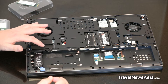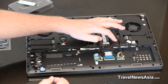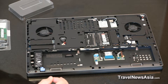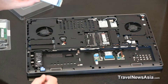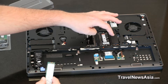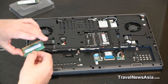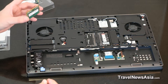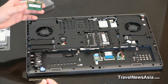You have another hard drive slot here — M.2 NVMe PCIe — another one here, and a fourth one over there, giving you a total of four M.2 NVMe PCIe slots. When the laptop arrived, it came with an SSD already installed. The one I'll be putting in today is actually an M.2 SATA, so slightly slower than the Samsung 970 EVO 1TB I have installed. The laptop was also configured with 8GB of RAM. Those 8GB modules have since been replaced by two 16GB DDR4 HyperX 2400 CL14 latency modules, which are very good.